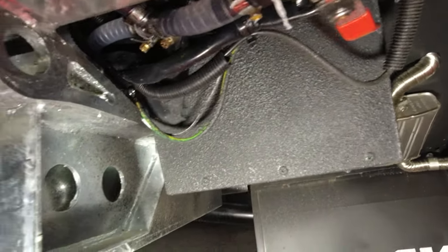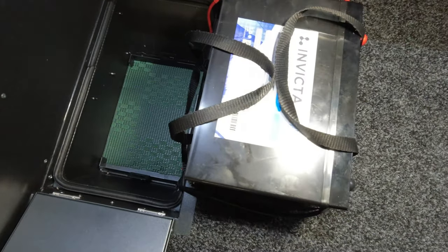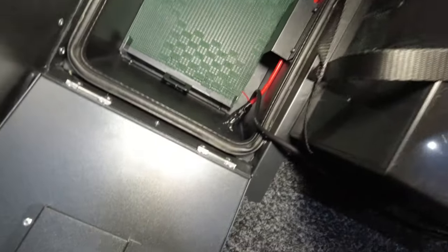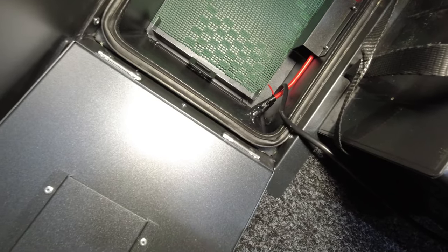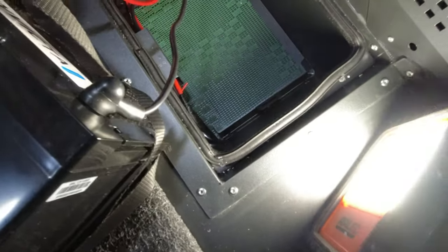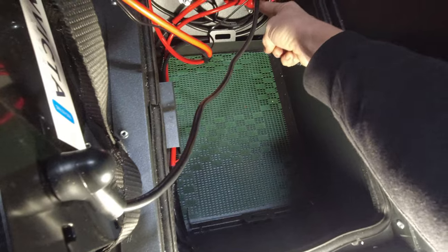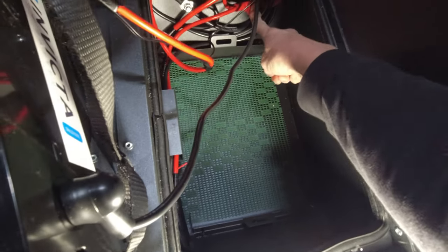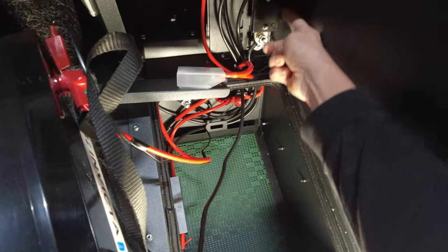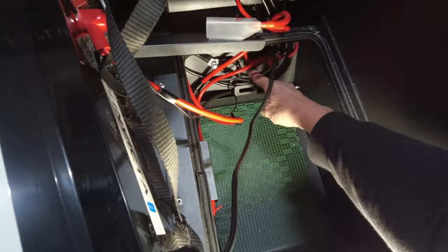Compared to what I'd be used to as an electrician, the factory wiring comes from the battery through a 60 amp fuse and disappears into that gluey mess through the side of the battery box. It runs under the camper across to this side where the positive goes to the terminal where the two batteries are brought together, and the negatives come up to the shunt and through to a ground stud.